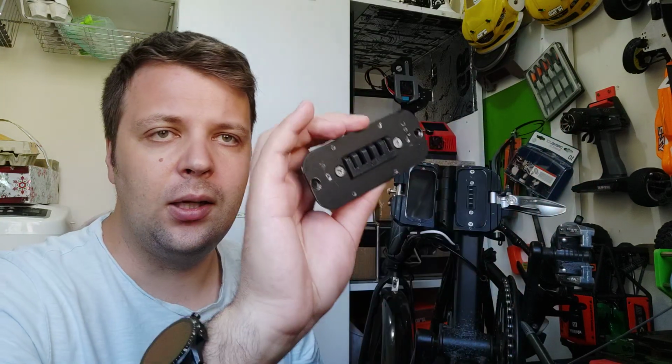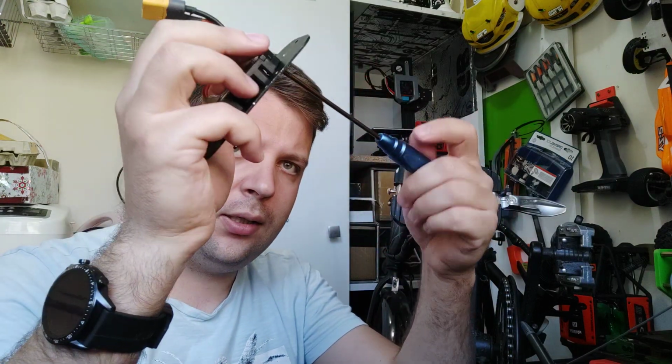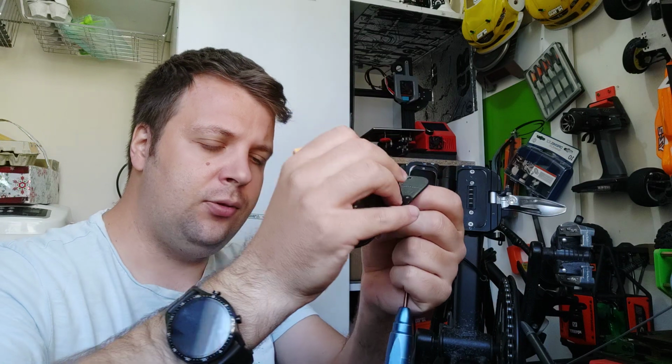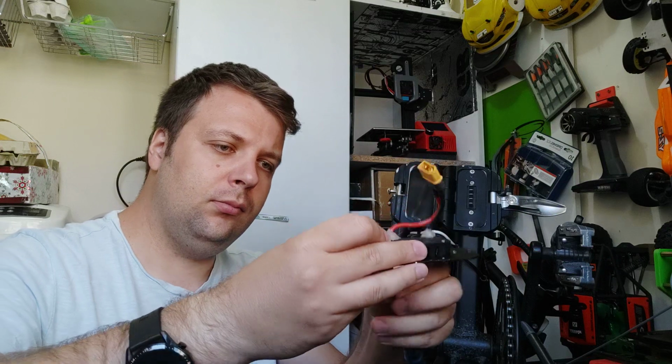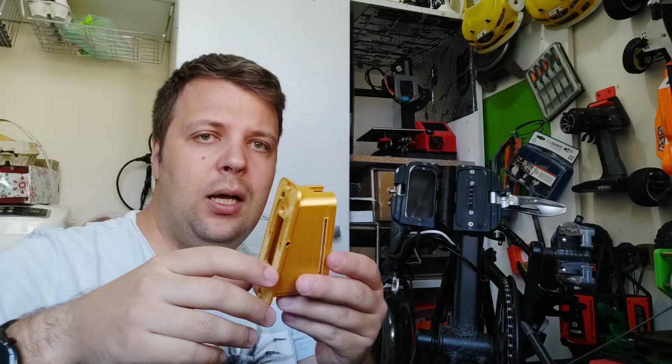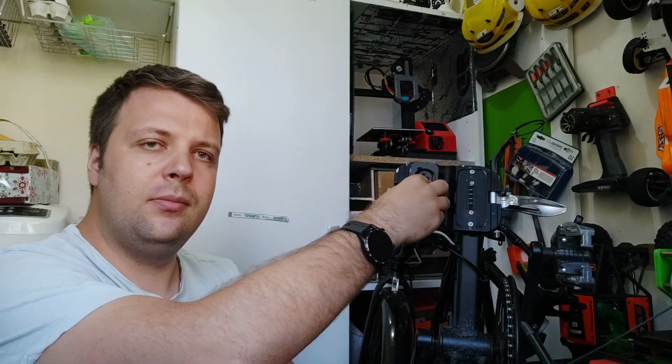Okay, so we took the top plate, and I screw in the two screws that we have. And basically we should have it like this. Good. Now we'll take the adapter. You'll see that the adapter has something like this. Here you must drill a 20 millimeters hole. So this will come where the hole for the charging port is. In my case, like this. Good. Now I will take this one, for example.